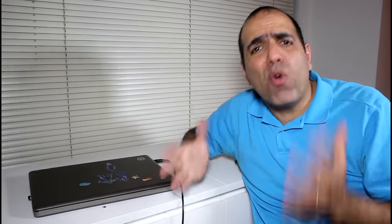Well, yeah, I had a desktop a while back, but I swear it was only a printer server and it meant nothing more. And now with the laptop gone, I can't even edit this video. So I'll have to fix it. You see, it's only half dead. The issue is that the cooling fan doesn't turn at all. The CPU heats up after a couple of minutes and shuts down, so I have to dissect it.